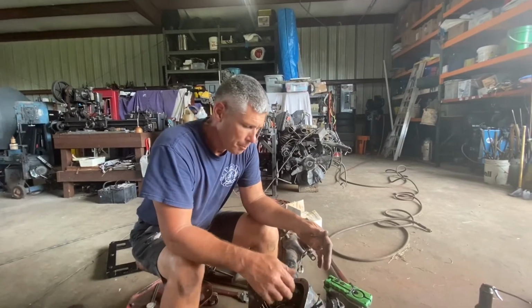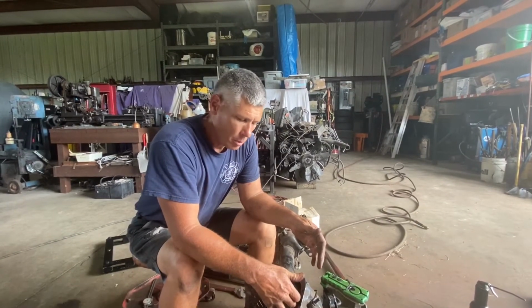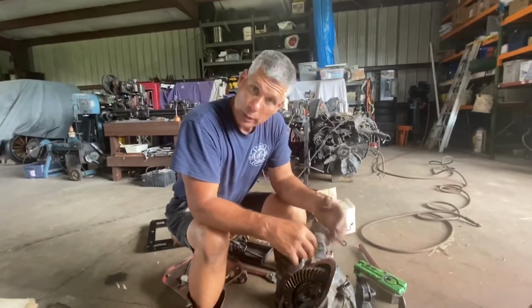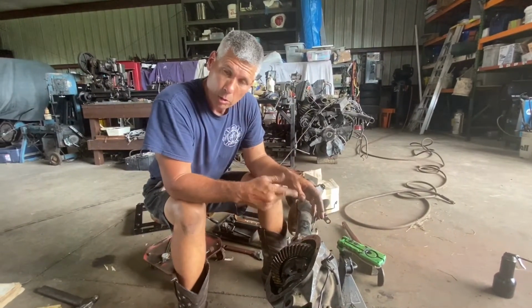I've got my setup bearings, which is the differential bearing, and the inner pinion race has to be able to come in and out because that's where the pinion depth shims go. So we have to completely disassemble this now, and you also set it up without a front seal, so you can get your pinion